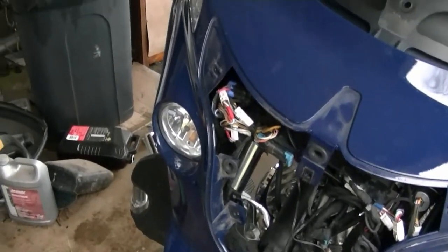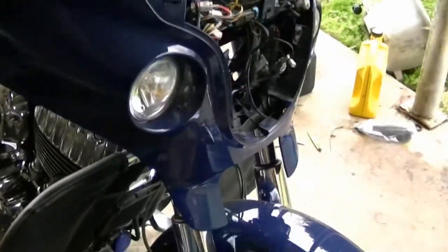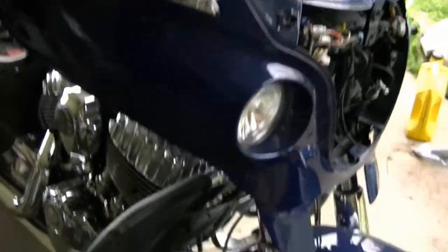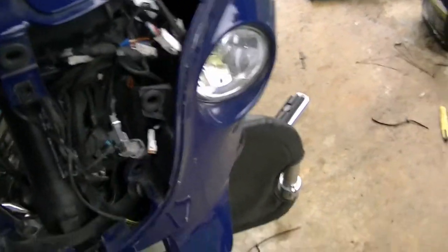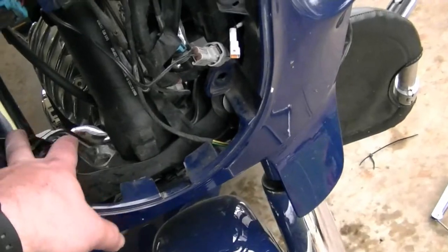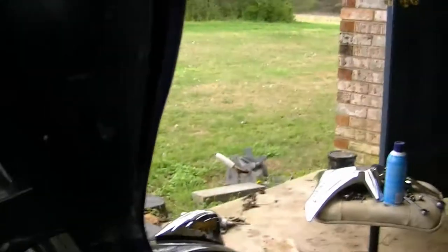I did not want to mount it on my saddlebags, so the first thing I did was take off the front fairing. I took some notes for posterity in case anybody else found any of this disassembly information useful. The outer fairing at first glance looks pretty easy, and actually it's not bad — it just takes a little time. I went ahead and took off the headlight first: two bolts over the chrome surround, then three bolts that hold the headlight on. Those are 10 millimeter bolts.